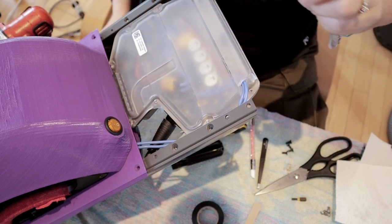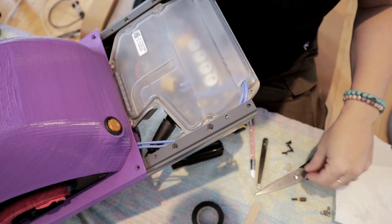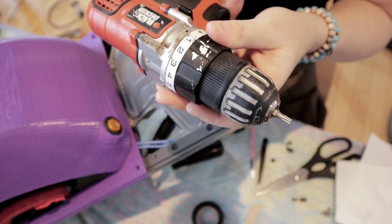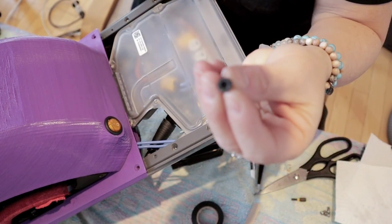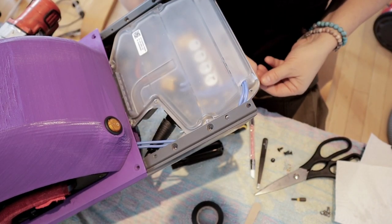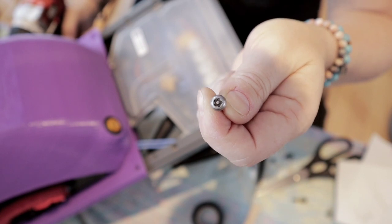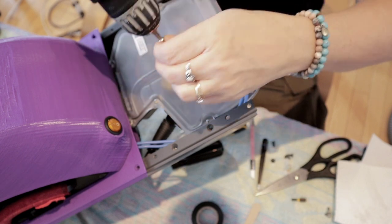Oh yeah, and before I forget, when you play with OneWheel screws, you need to be very careful and keep your torque down if you're doing it with a drill, because you can break the screws and you don't want to do that because they are special screws that they use to put on the wheel. So be careful with that. Like the ones here, they have this little pin inside. So you want to be careful. So here goes.